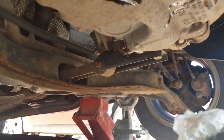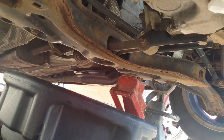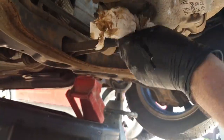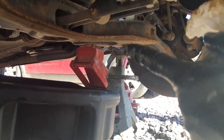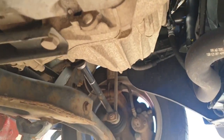The true work of the video — clean off all around the bung area just so it looks a bit better. It'll dry up anyway, but it's always best to do it. While you're under the vehicle, make sure you've got it properly propped up with an axle stand and jack. Check your CV joints — you can always tell if they're leaking or split because you can see oil or grease all over everywhere. Also check brake hoses and pipes, and see if there's anything untoward. As you can see, it's spotlessly clean. Check your poly V-belt or serpentine belt.